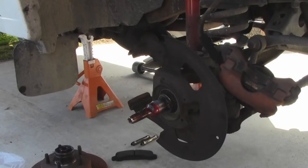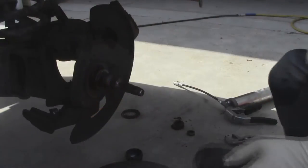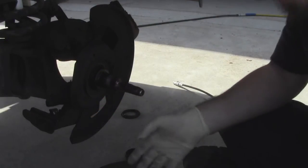I'm going to open up the new rotor and re-grease these bearings that came out of the old one, then throw them back in the new one. The bearings are still good. I think the original owner did these rotors before I bought the truck - some things still look new. I'm going to swap over the bearings and we'll be good to go.